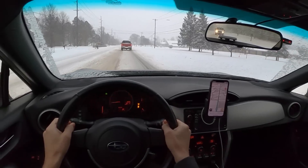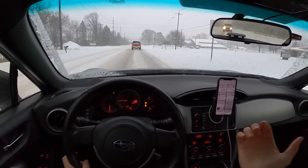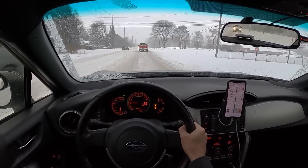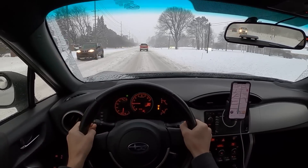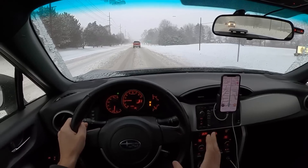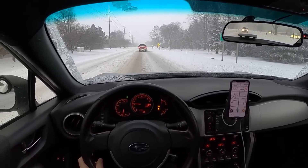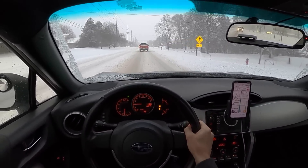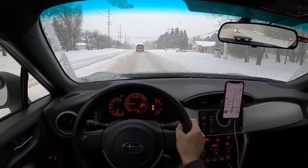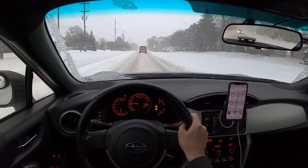Alright guys, we'll wrap it up there. I just wanted to show you how well the BRZ gets through this deep stuff with the new setup — it performs pretty well on these 17s. When I first got the car in 2014, I swapped on 225/40/17s from my Mk6 GTI, and they were so wide that the car had a lot of trouble getting started in deep snow. So my recommendation is to go as narrow and as tall as possible. Thanks for watching — stay tuned. We'll drive the Lexus next and see how it does in the slick stuff with the new all-terrain tires.